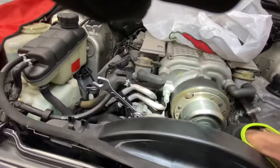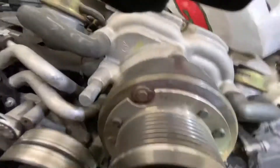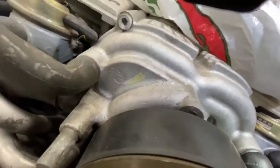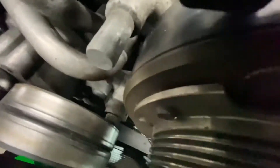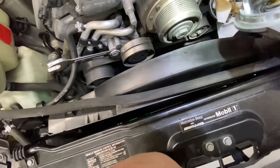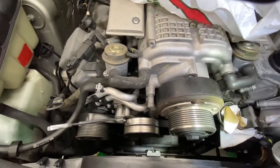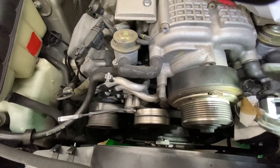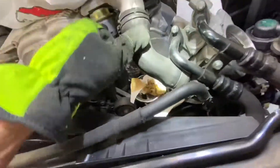There it comes off. You tilt it down — I just yanked on it and tilted it down. I've already drained the coolant out into a bucket. I guess I should have released this hose but I didn't — that's life. And there we are. I had no problems with the thermostat. I'm going to take a look at it and probably replace it. I think it comes as a whole unit — thermostat housing with the thermostat. But we got that done.